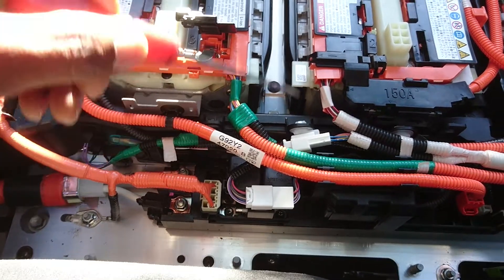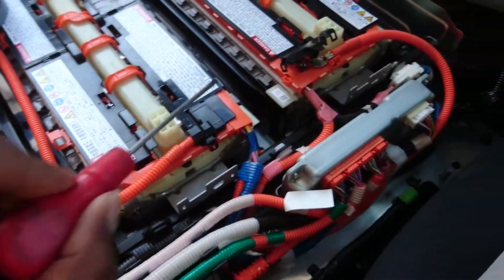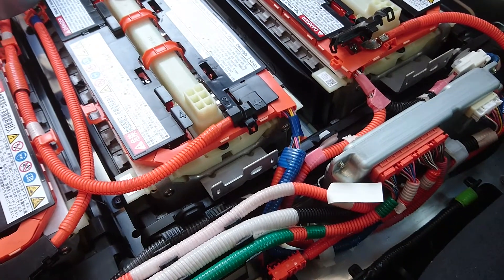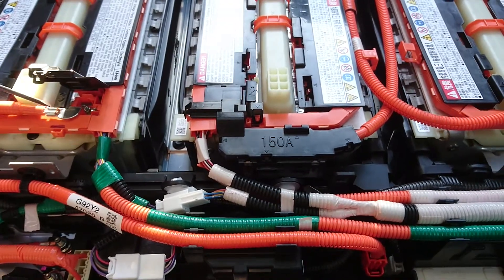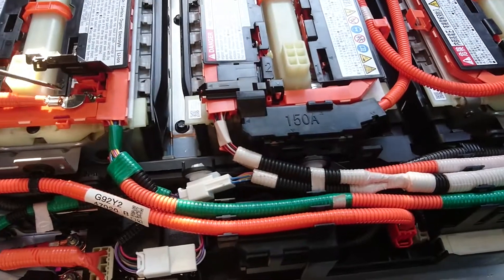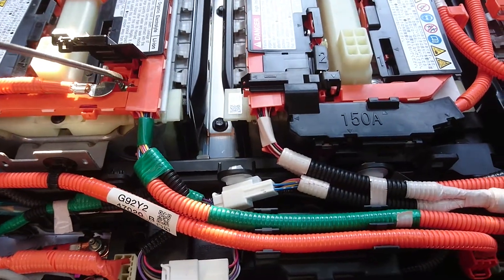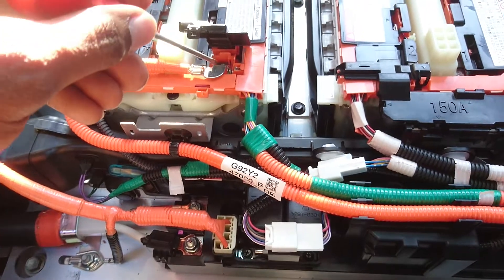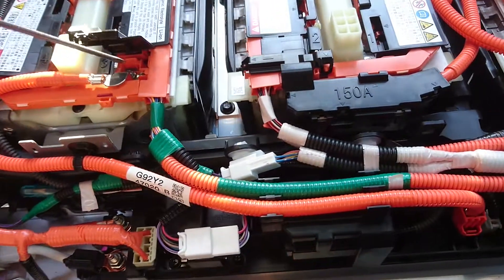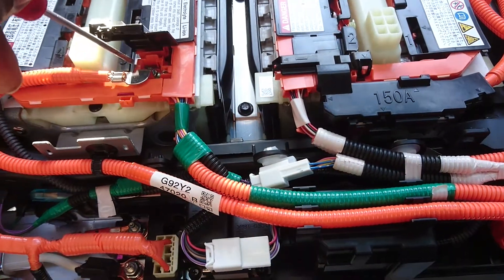To avoid the risk of forgetting the switching sequence, you want to connect from here — as long as there is an isolating connector on the other side, you will have power here all the time whether the car is on or off. Right now, if I touch the negative here and positive there it will kill me straight away. But I can touch here — I've already tested with my multimeter, there's no power here at all. I wouldn't want to mess around with this part because this is the battery and it's live. So listen carefully: if you are doing any range extending, it's here where it's live all the time.